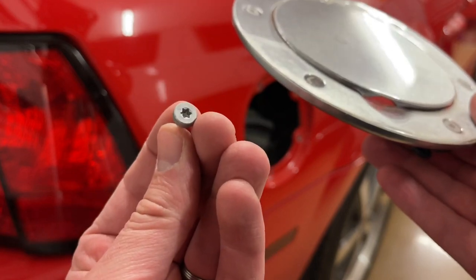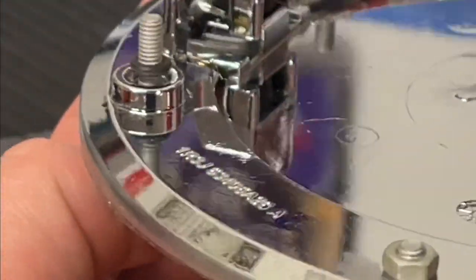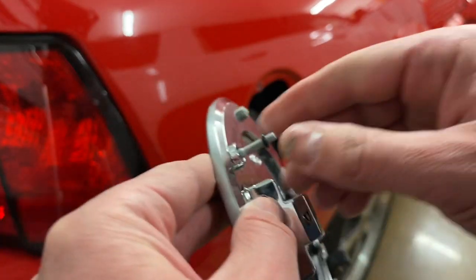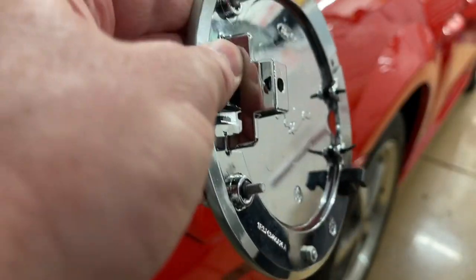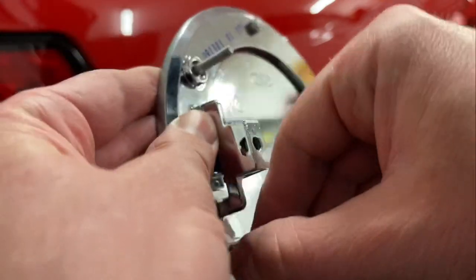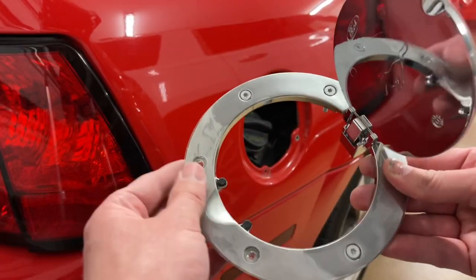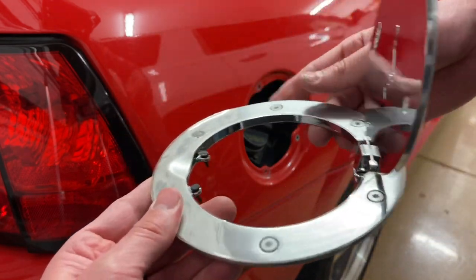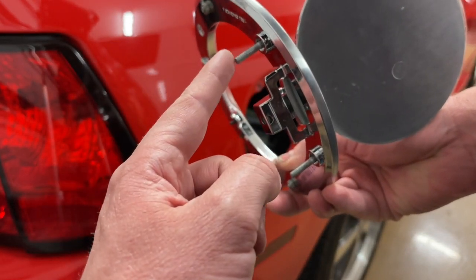Keep them nearby — we'll be putting them on once the fuel door's in place. These are the ones closest to where the fuel door opens, just those two black little clips. Put the hardware aside; this is very hard hardware to find and it rusts easily. We're also going to take off these two screws here. The very front two, which are by the hinge, have a little rubber piece on them, so we'll take that rubber piece off. Up close you can see they're just tiny little O-rings. Those two studs will now just basically be floating in there, so don't let them fall to the ground. We'll just line them up — we will need to go to a hardware store and buy little nuts that will go on the back of those.